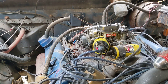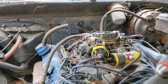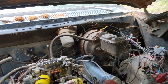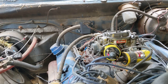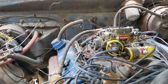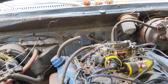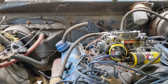These old Dodges, pretty much from the 80s — first gen all the way up until the 90s — they used this voltage regulator here to control the voltage. Back in the day it wasn't a big deal, and they worked great when Chrysler was making them. Now everything's made in China and it's junk. The problem is these regulators last about a year, then you fire it up after sitting all winter and it shoots up to 16 volts, overheats your coil, and you're stuck.